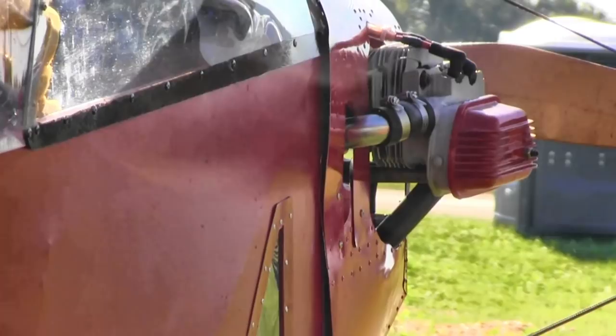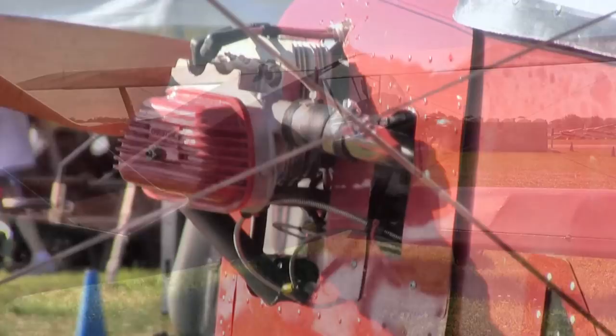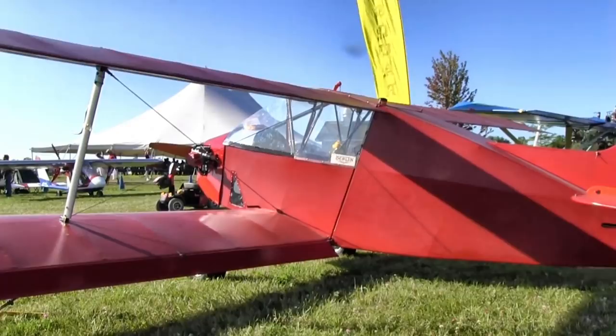It uses standard stick and rudder three-axis controls, with full-span flaperons on the lower wing, a center-mounted stick and left-hand throttle. For the best performance, a Rotax 377 or 447 two-stroke engine is recommended. Other engines that have powered the Hyperlight SNS-8 are Hirth, Kawasaki and half VW conversion. Climb rate comes in at around 750 feet per minute, cruise is 55 to 65 miles per hour, stall comes in at 27 miles per hour.